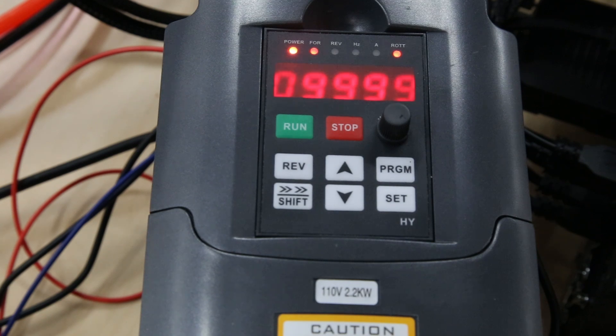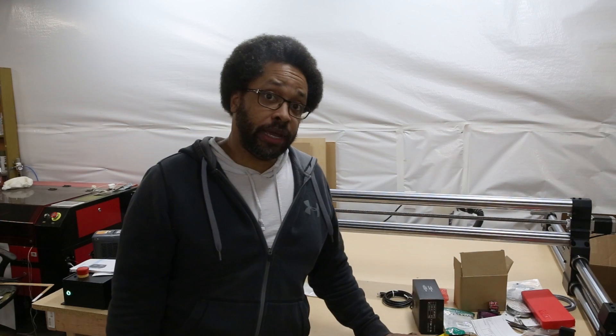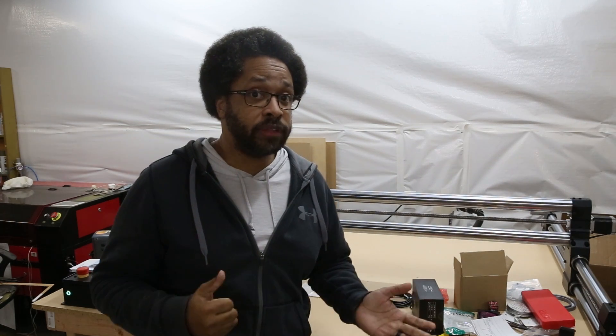I count that as a win. Despite a lot of cable management still needed, we are set up with our spindle and VFD connected to our Onefinity controller. The controller can command the spindle to start and stop, the VFD now displays the correct RPMs — we fixed that default setting where it was only showing half the number. Just go open up the settings, change those two values, and lock it back down. Thank you for watching — I hope this was informative. This was probably the easiest part of the whole spindle setup. Leave any questions below.